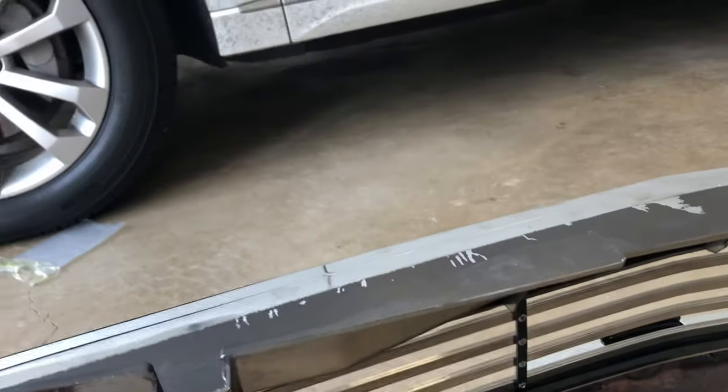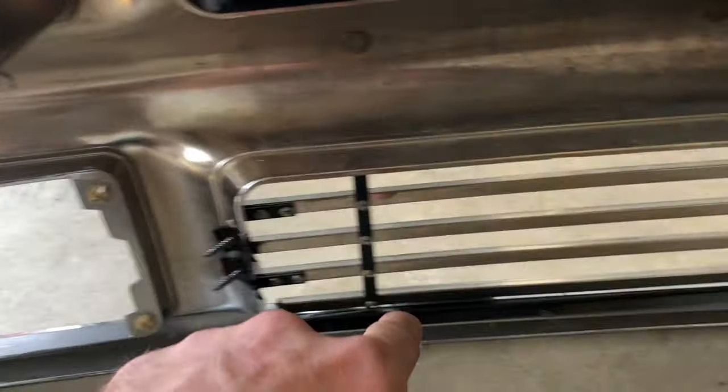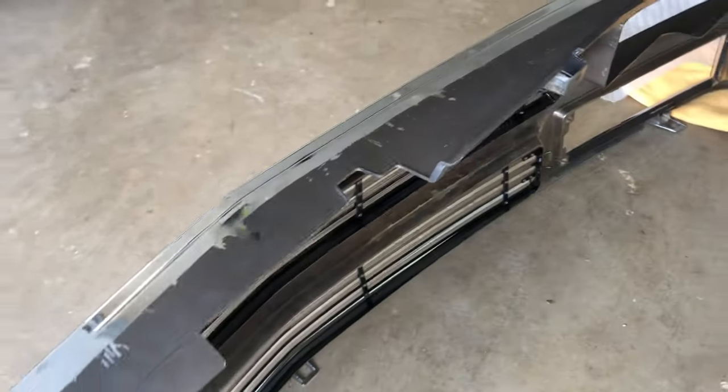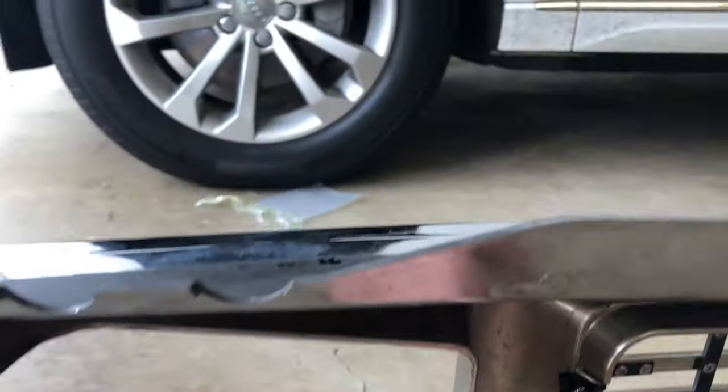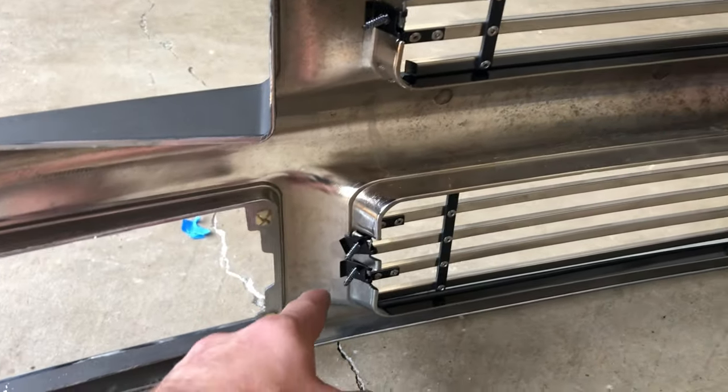After that it's your choice — it took me a little longer, but you can paint it if you want. It looked kind of jagged and janky from when I sanded and cut those off, so I went ahead and painted and masked off the whole grill, painted the insert area gloss black. Then from there you got to drill eighth-inch holes on each side.